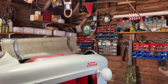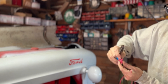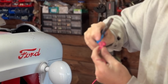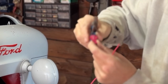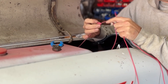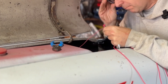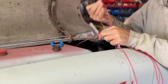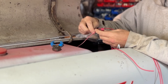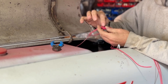The best tool for this is a pair of slip joint pliers. There's a little blade in the middle, and when that blade goes through it makes an electrical connection between the existing wire and the new wire you're tailing onto it. Two things to remember with scotch lock connectors: clamp down straight and perpendicular — don't let the blade go off at an angle or you won't get a good connection. Also make sure your tail wire is fully bottomed out in there so the clamp comes through and bites it.